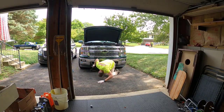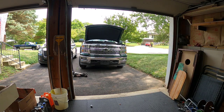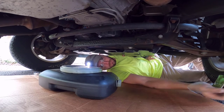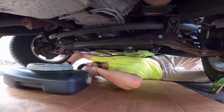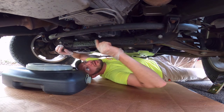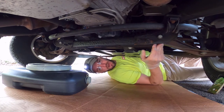This video is really about changing the oil, which is super simple. Alright folks, so we're up under the truck. We're going to go ahead and drain the oil — step one, besides jacking it up and putting it on jack stands. This right here is our drain plug, and right here is obviously our filter. Start here. Now the oil is warm and you want it warm — that helps it flow better.